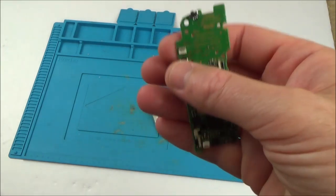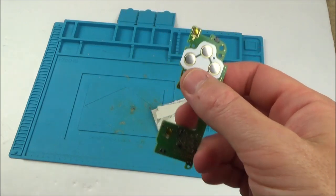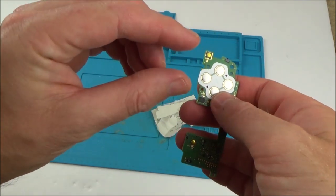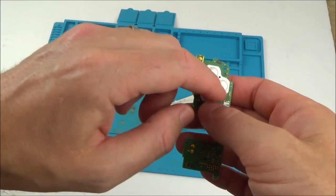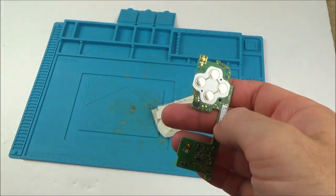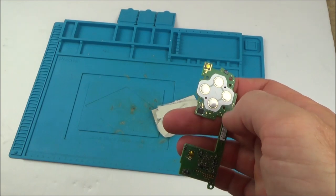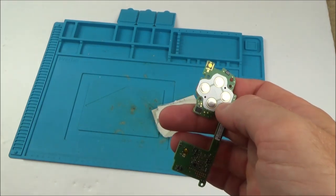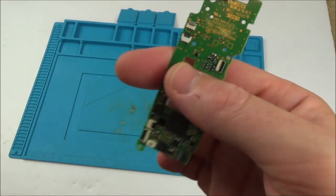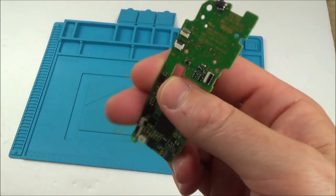What I'm thinking straight away — and I haven't put a multimeter near this yet, I haven't done any testing at all — is that all of the buttons might have a ground connected to them. When we press a button it's just connecting two little carbon tracks together; there's a little metal plate that shorts across them and completes the circuit. So I'm thinking maybe each button has a ground that they're all in common with, and if none of them work, maybe the main ground is damaged. That's only what I'm thinking initially — it probably will turn out to be a chip or something, and it might not even be repairable.